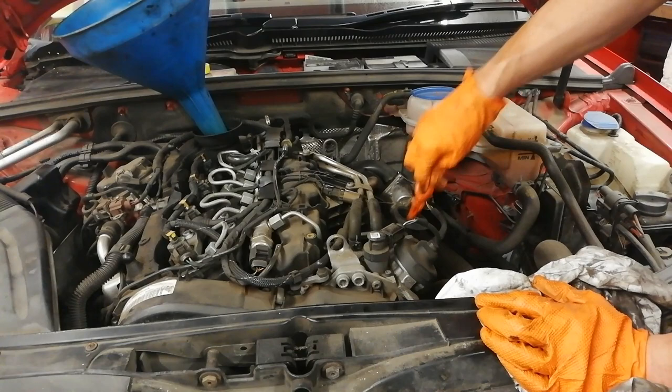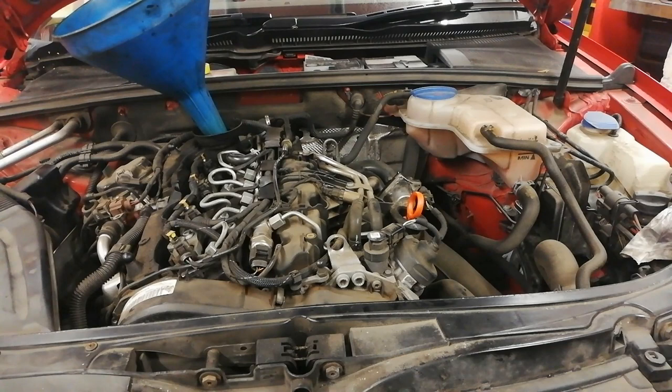In this particular one the dipstick clips in, so it needs to be fully home to get a proper reading. Pull it back out and that's it — filled right up to the top. It took just over 4.3 litres, probably because the filter housing had taken some. I'm just going to top up the power steering fluid, change the air filter, reset the service light, and do a quick scan. Hopefully there were a few hints and tips in there. That's the exact procedure I do with every car. Many thanks for watching — all the best and bye bye.